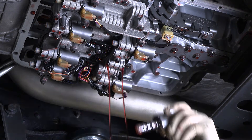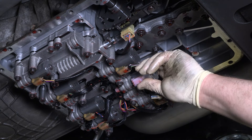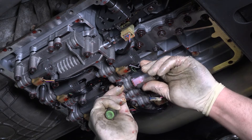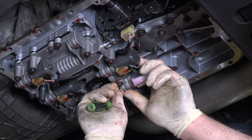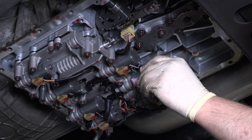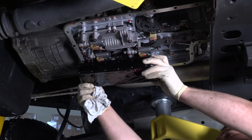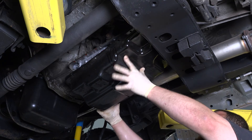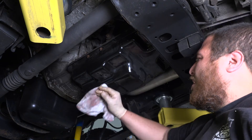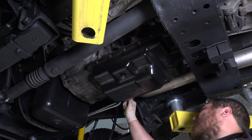Install your new solenoid at the 6 o'clock position and then rotate to the 7 o'clock position. Remember, the included plastic cap must remain installed on the end of the solenoid or damage to the transmission can occur. Apply light pressure to the solenoid to reinstall the solenoid retaining E-clip and reconnect the solenoid connector. Reinstall the transmission filter, then clean and reinstall the transmission pan with the pan gasket. Torque the transmission pan bolts to 11 foot-pounds and the drain plug to 13 foot-pounds.